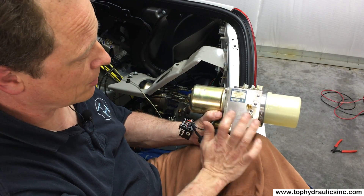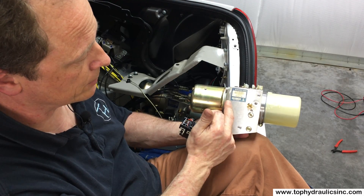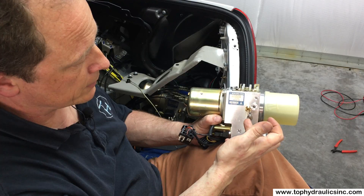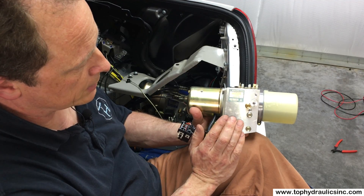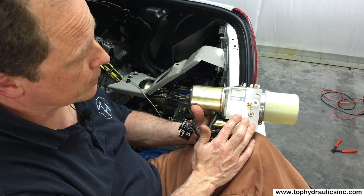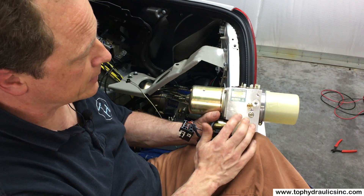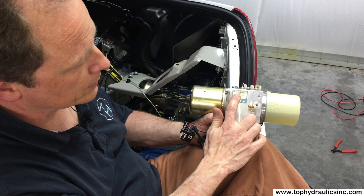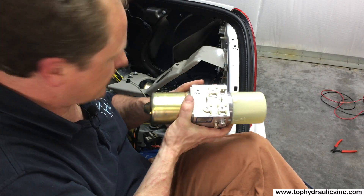We have replaced and upgraded all the seals, including the oil seal to the motor, which is able to take a lot more pressure and will last longer than the original. Tolerances on all the pistons in the rotary assembly are perfect, and the solenoid valves have been gone through and checked. This pump is certain to ship performing better than a new one — putting out more power than the original Mercedes pump from the dealer. Part number 170 800 0030, officially 170 800 0148.